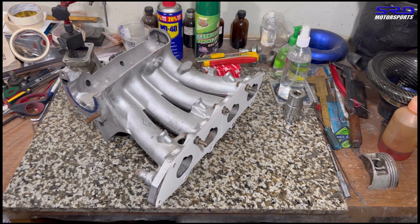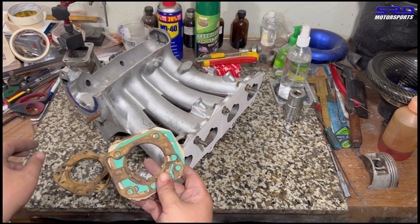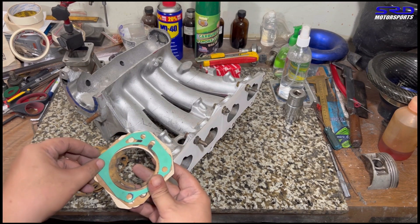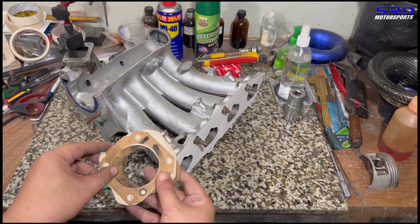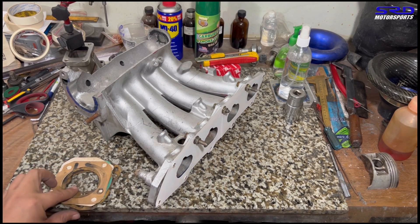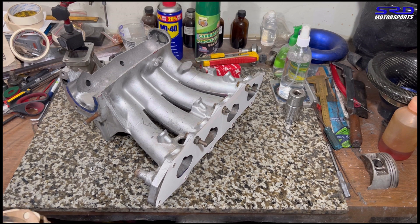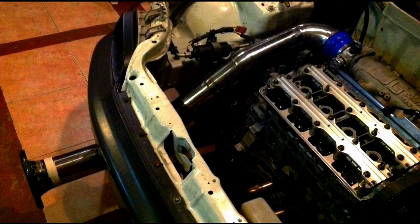For the throttle body it's simpler — 70mm or 74mm throttles come with a gasket, but we still retain custom-cut throttle body gaskets as well as some OEM ones. The 60mm is often used on the D-series single overhead cam intake manifold; if the owner is going with a B16 or Type R throttle body, we do 60 or 62mm. Subscribe because this is all the good stuff we share.